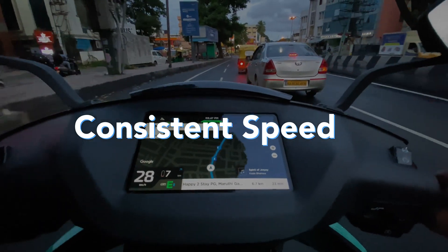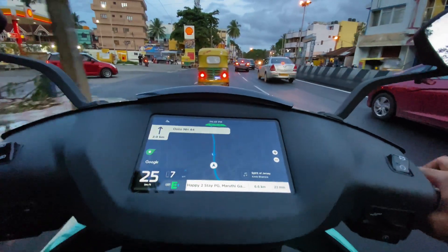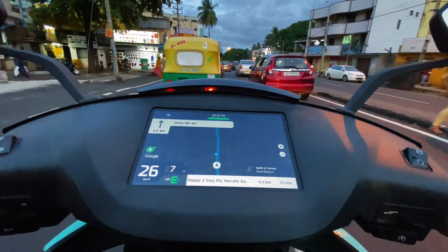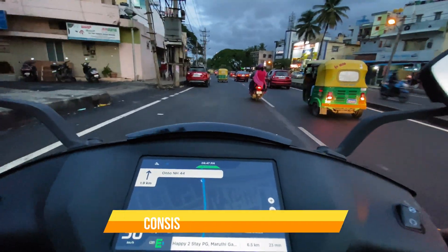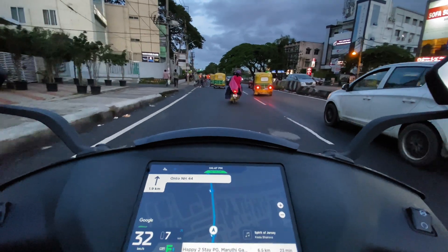The first trick I'm going to use is to maintain a consistent speed. If you have an electric bike, particularly Ather, if you can maintain a consistent speed, you'll get much, much higher range than what was projected on your dashboard. I'm going to maintain consistently a speed between 25 and 35 kmph. I don't want to go as slow as 15 or 18 kmph — who wants to ride at that speed? From my experience, I've always got a range of 5 to 10 kilometers more by maintaining a consistent speed.